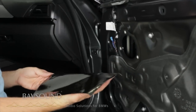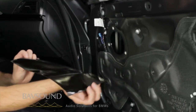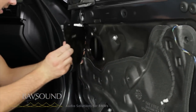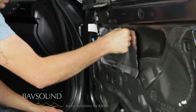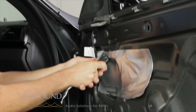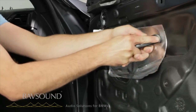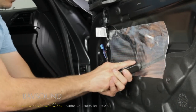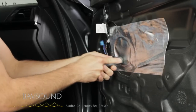I've cut off about a six-inch by twelve-inch piece of our sound deadening kit — you've got some for this door, some for that door, some for each door, and anything left over we just add. I heated this up with a hairdryer just to get it pliable, and we come over here and get it all up in the area — it's tacky. We're just getting it applied, then taking the backside of our panel removal tool and laying it down as well as we can. You can see how it adheres perfectly to the panels and surfaces, bridging all the pieces together, and you can see the cutout for the speaker.